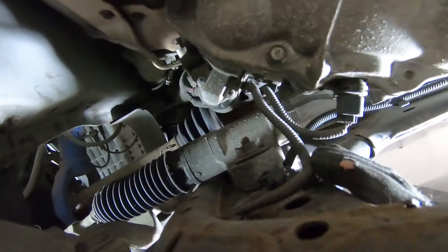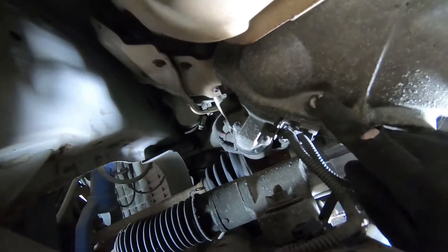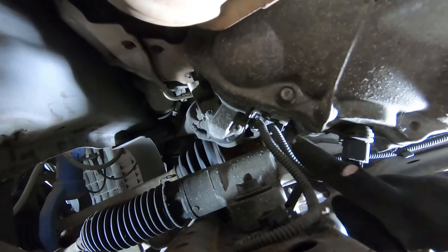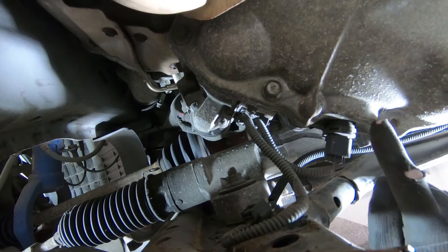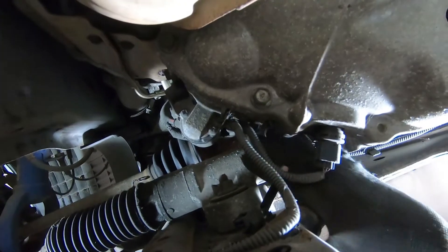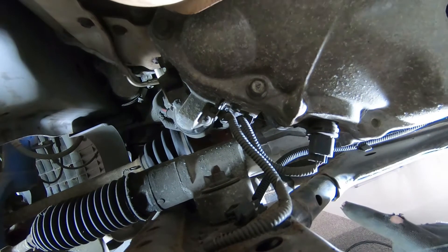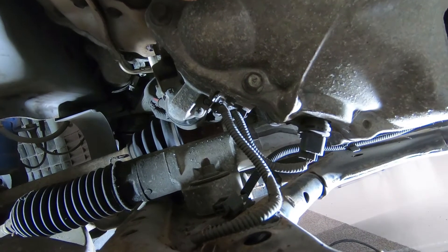You'll be able to see here, this is the back of the starter motor. It looks like these two bolts here are going to release that, but before we do that, this electrical harness here — there's a sensor that goes to the flywheel by the look of it, and there's some other cables which are actually attached to the starter motor itself. We'll need to remove this wiring harness from the bottom, and then we can move around to the other side through the wheel arch and remove the electrical connectors.